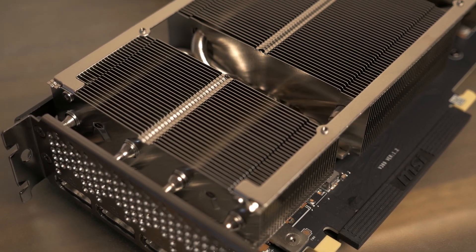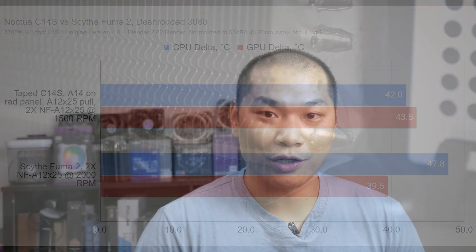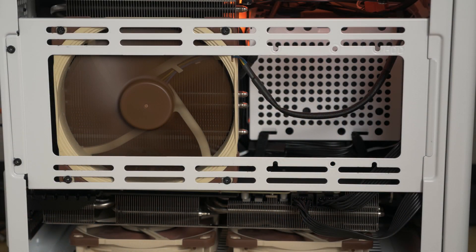For a quick comparison I down-clocked to 4.1GHz to compare against the Fuma 2 with the de-shroud mod. It wasn't quite apples-to-apples since I had to drop the bottom fans to 1500 RPM to noise-normalize. In testing with the Fuma 2, the NF-A12 running at 1500 RPM yielded slightly higher GPU thermals, and not quite apples-to-apples since the Fuma 2's max fan RPM of 1200 meant I really needed to push the bottom fans hard to get to the same noise levels. The A14 fan makes noise levels harder to equalize between these two configurations since it's a louder fan directly mounted on the outside panel, which triggers a decibel meter more than fans inside the case. Technically you could also drop the CPU fan speeds to bump up the bottom fans — those are all adjustments you could make on this curve to suit your preference and how you balance GPU to CPU thermals.